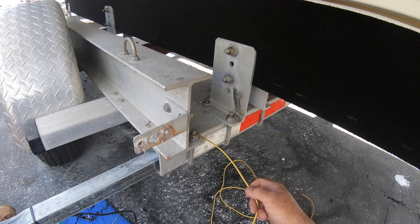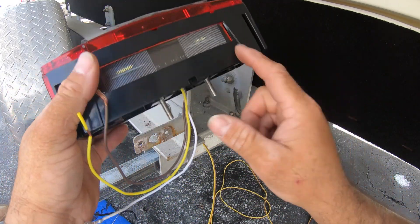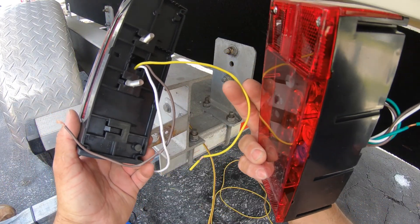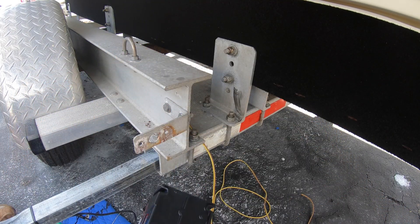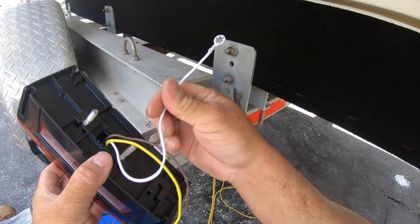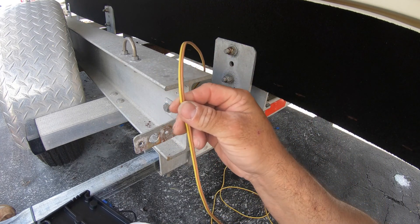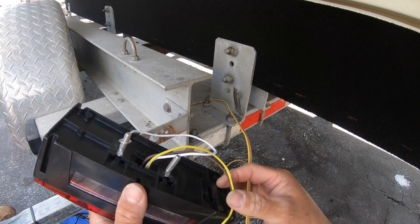On the port side of the trailer we're going to install the tail lamps. The port side has the clear lens underneath and the starboard side does not. Another way to figure that out: the port side is the yellow wire turn signal and the starboard side is the green wire turn signal. Now we're going to splice in two wires. This is a little different because we have an additional third wire which is the ground, so we're going to install the ground onto the actual stud as we install it onto the trailer bracket. We have our yellow wire — the turn signal — and the brown wire — the parking lamp wire — and we're going to splice them into the tail lamps.